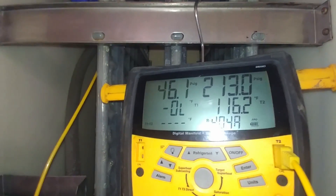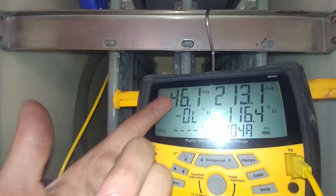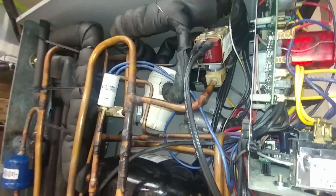46 psi, 213 — we should expect to see this pumping down. So, you wouldn't want to diagnose the compressor as being bad if it's just your hot gas valve, because it'll seem like the compressor reeds have gone bad when really it's just the hot gas bypass. Lots of things to be paying attention to in these ice machines.